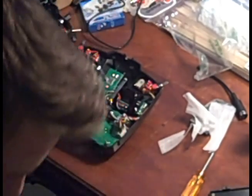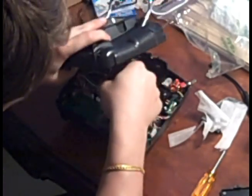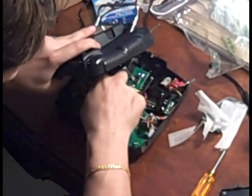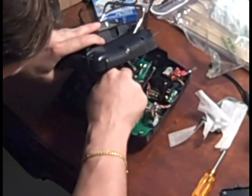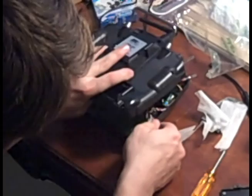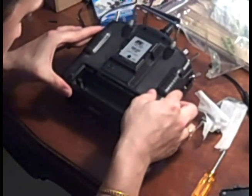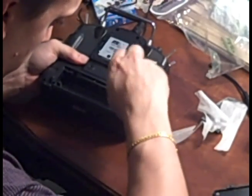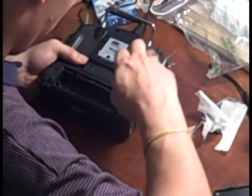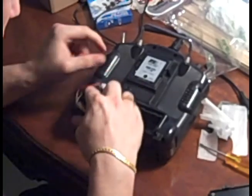Now plug the extension of the backlight wiring into the original plug socket. And that's it. Take the back of the transmitter and re-plug it into the same PCB board. Replace the cover back onto the transmitter, re-screw the six screws, and after that you can replace your battery.